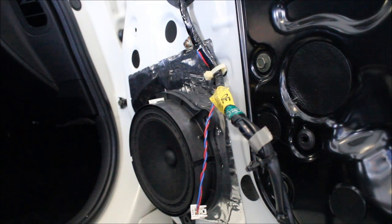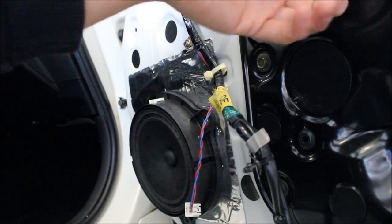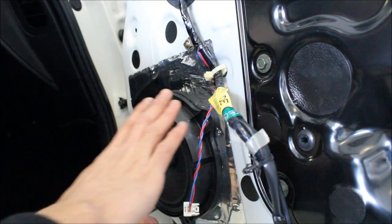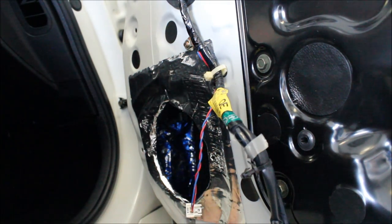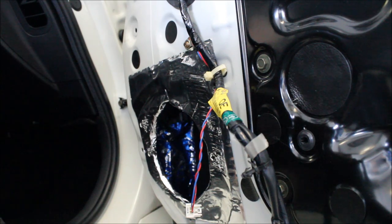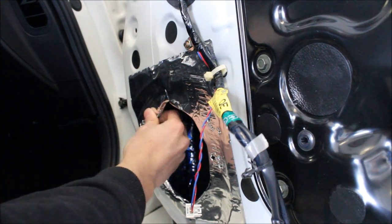Now we're just starting to lay out where the speaker's going to go. The nice thing about using these adapters is for the most part the holes line up, though I will have to modify this one a little bit. First, we're going to add some more sound deadening to certain key areas to reduce resonance in the panel, but we're not covering up everything because we want this to be very serviceable — you have the window regulator and windows to deal with. After you've done the first bit of sound deadening where the speaker goes, try to leave the back portion open so you can reinstall the factory speaker as a template. I marked off all my holes where the bracket's going to go because I want to reuse the factory holes. Some people lay material in and then cut out the middle — I feel like it's a waste. I cut it into pie slices and fold it back on itself, so you double up how much material you're sound deadening.